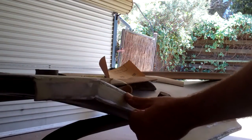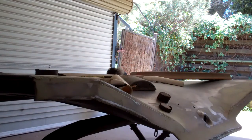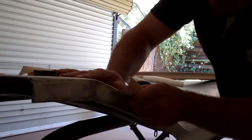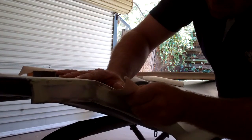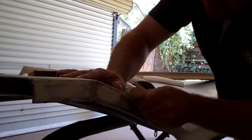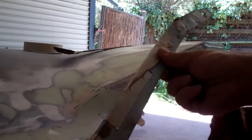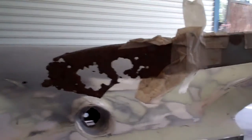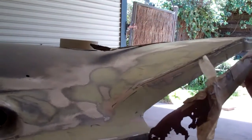I've just got a nice groove in there with my ruler's edge and now I'll put some 80 grit paper around that and just start filing inside there. This is the old rusty wing piece that I've cut off and I've kept this for a reason — basically so that I can trace the slots that go through here onto my new piece. So that's going to go on the wing now.